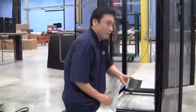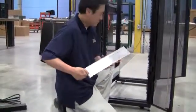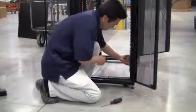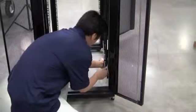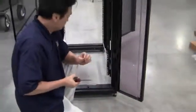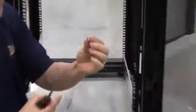Once you've identified where in the rack you want to install your library, go ahead and grab the rear end piece. Go to the back of your rack, identify where the library is going to go, and grab your screw and your washer. One item of note: the washer is uneven, so you want to make sure that the narrow side is pointed towards the rack.